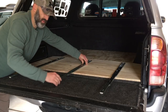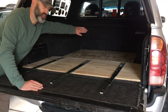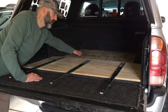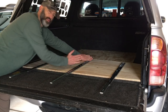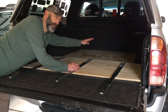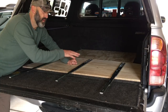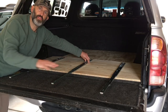With the bench back there, that will be a removable pad or section that will replace the portion that slides out. We're going to put spacers in there - this is just the subfloor - and make sure the bed portion that comes from the back rests on these. When this goes back in, it goes back in 24 inches and the spacers will be set back about 26 inches, leaving two inches for that portion to rest on. When this slides out, that 24-inch piece will come in and replace it, making the floor continuous. So we're going to cut those two pieces and then bolt or screw them in and start figuring out the dimensions.